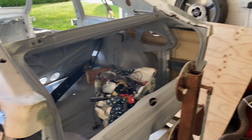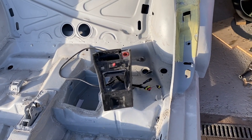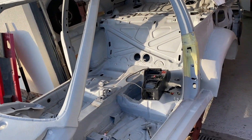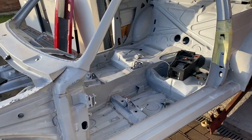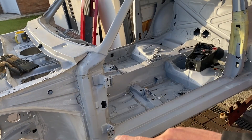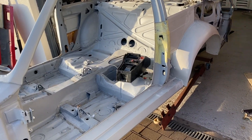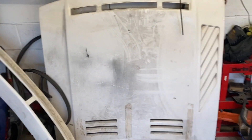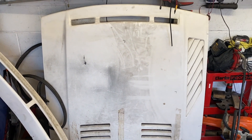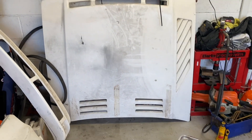There are a lot of body modifications needed for this car - we've taken the 320mm out and put in the windscreen slope. Because he had the four-door as well, he's been able to line it up: you cut the post out, bolt your four-door door in and it gives you the angle perfectly so you can work out your clearances. It's been great to stand in front of this car and also look at the bonnet, since I'm going to do mine in sheet metal. I've taken pictures and measurements so I can replicate it in the future.